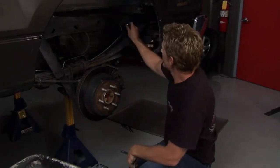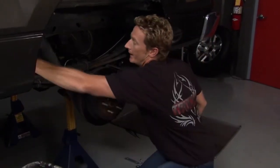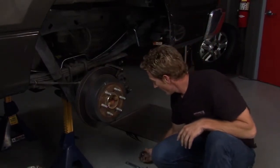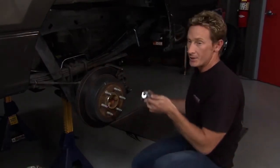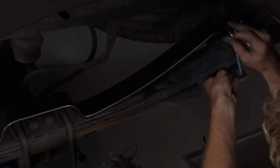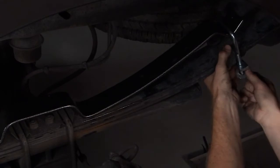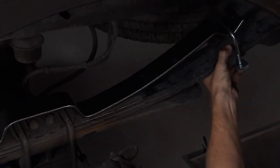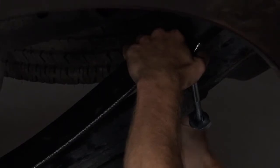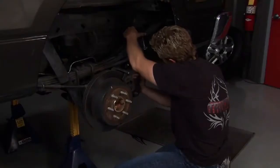What you've got to do is use 7/16 U-bolts in the back and they'll give you bigger half-inch ones you use up here in the center. We're going to go ahead and use this smaller crossbar across the back because they're not going to have as much of a load on the thicker ones up front with the half-inch ones. What we're trying to do is just set like a preload on these helper springs. The idea is you don't want these things to be bared down on too far because it'll make your suspension really stiff when you don't have any load in the truck. So I'm going to zip these up.